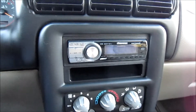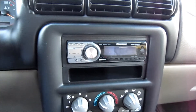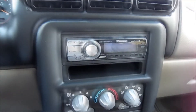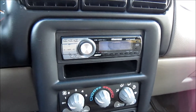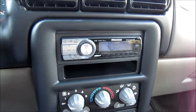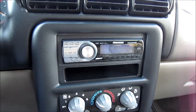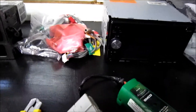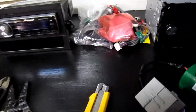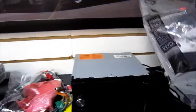Today I'm working on a 2001 Pontiac Montana and we're going to switch out a single DIN for a double DIN. The nice thing about having an aftermarket radio in this vehicle is we get to reuse some parts — the antenna adapter and the wiring harness module, which tells the deck to turn on, maintains retained accessory power, and keeps our chimes. The only thing we can't reuse is the mounting kit, since this one only accommodates a single DIN.